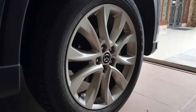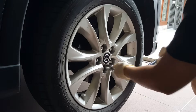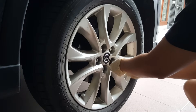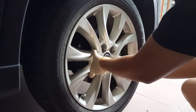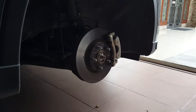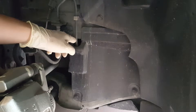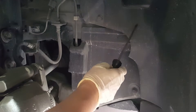Now we're just going to remove the wheel to access the crankshaft pulley. To access the crankshaft pulley, which is hiding behind the splash guard, we have to remove all these plastic clips — one, two, three, four — and one right behind here using a flathead screwdriver.